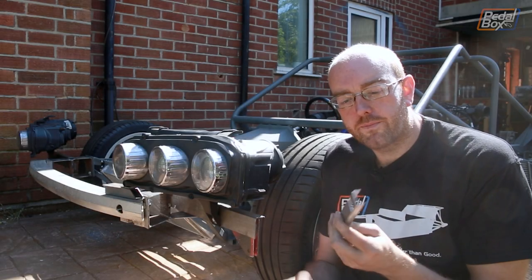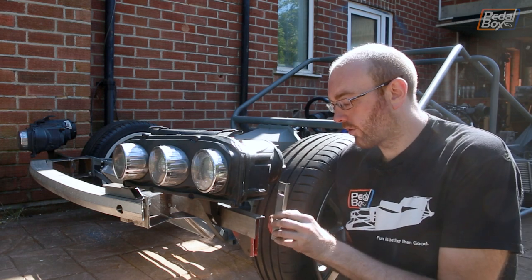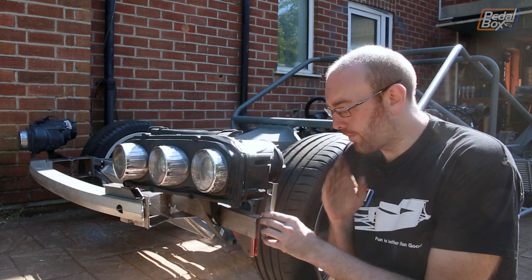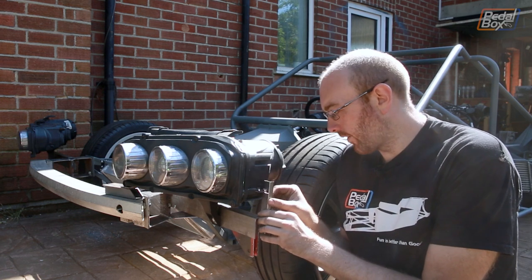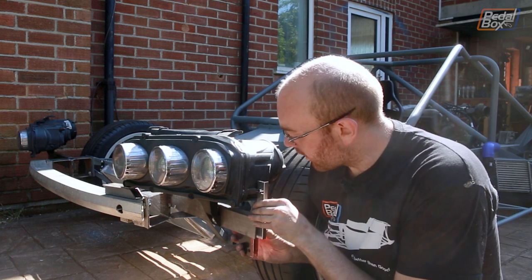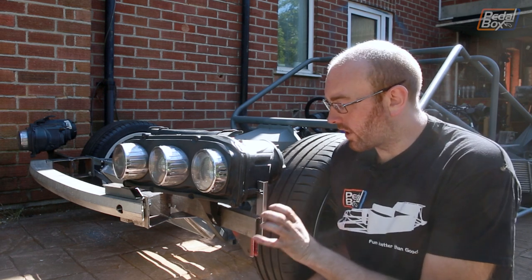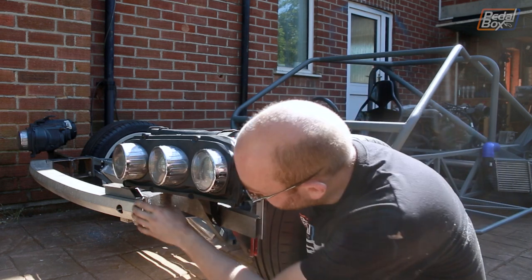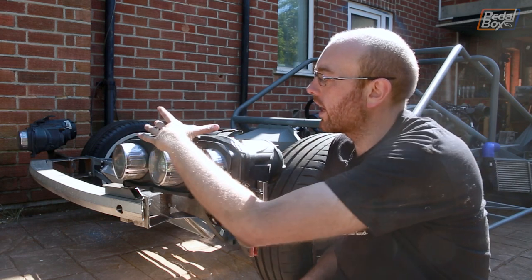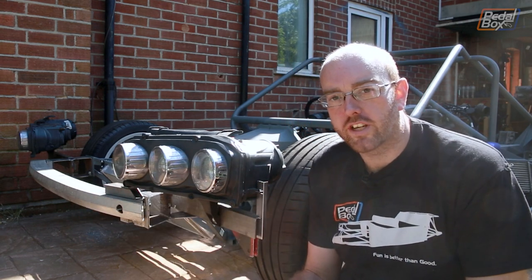This is the piece we're going to be welding on. I've opened the hole out nice and wide at the top so this can move side-to-side. I've also eased this another 5-mil in, so it's going to sit slightly further in, but that's not going to be a problem for the outside edge of the car. This fits really nicely on here. With this little mag clamp, it comes up to the back edge of the light pin, so with that in place I can weld this in. I've leveled the light off using some box section and a couple of shims, so it's nice and level across the top of these lights and the top of these two brackets, level with this bar.